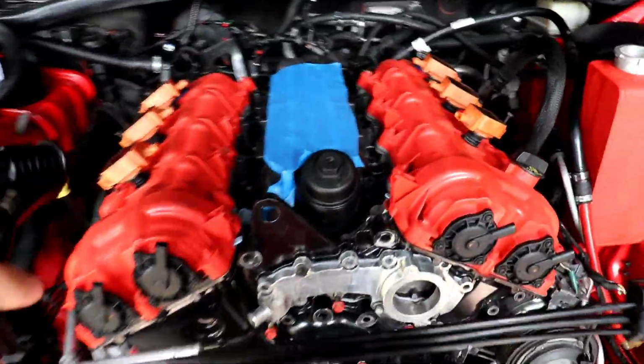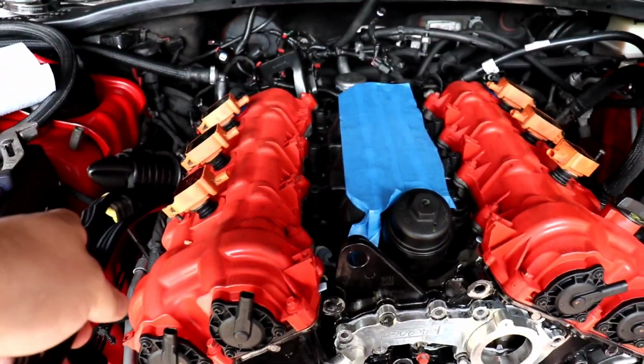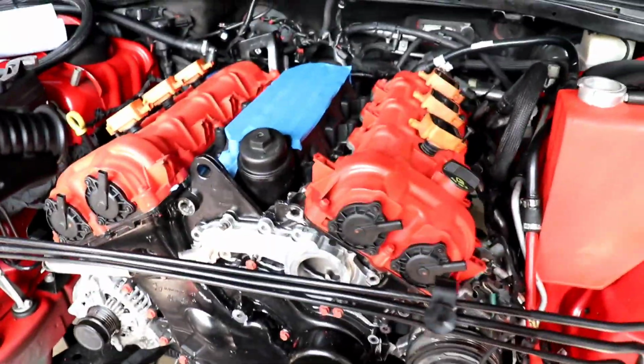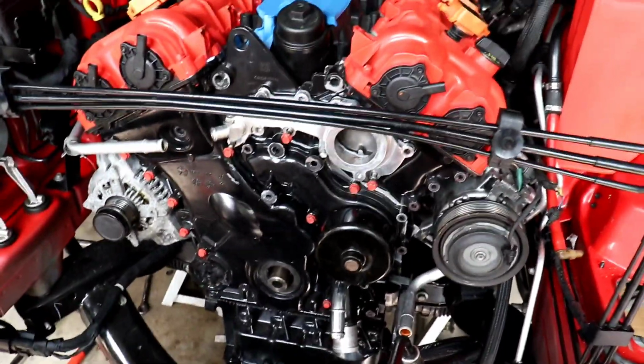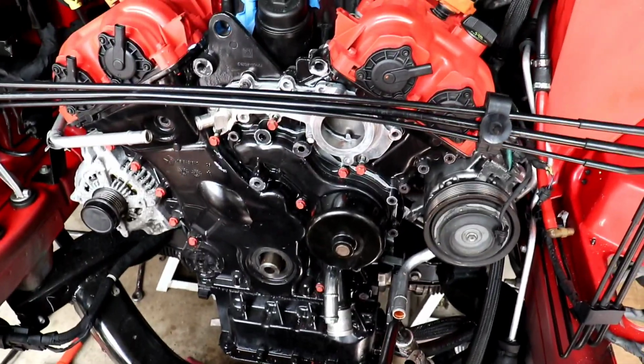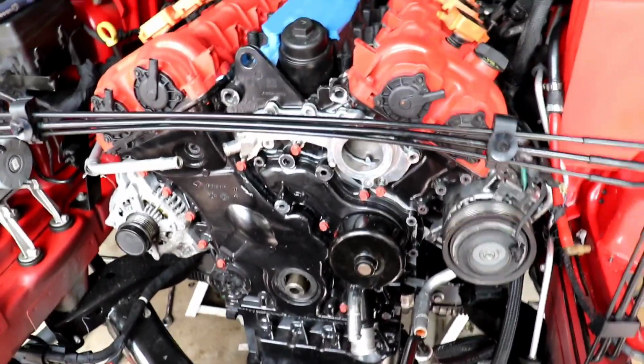And then we're going to be pulling the valve covers, which means we have to pull the coils, we have to pull the plugs, and we're going to be changing out the lifters and the rockers. And then it's about really putting it all back together. Yep. Torquing everything, and then next week we'll throw fluids back into it and hopefully have this car going up and down the road. Now, another thing I want to teach everybody.